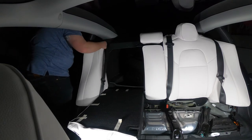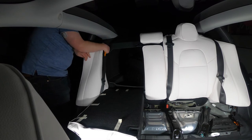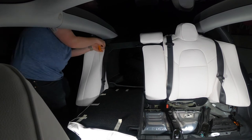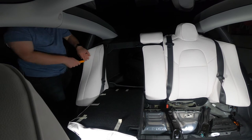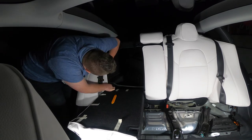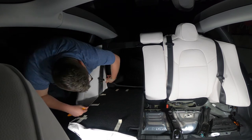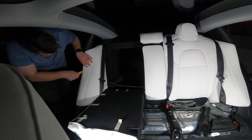You'll have a hard time feeding the straps up through the bottom, so make sure you use your wedge tool. Work the edge pieces into the grooves — be careful doing this because there are clasps in there and you don't want to snap them. This is very involved; be meticulous with it. If there's any puff in it the door won't shut properly. The inside edge has a stiff piece so it'll be easier to get in first. The top and bottom corners you'll have to stretch into place. Sorry for missing footage on the other seat covers, but follow the same process. The headrest is really easy — there's one velcro strap in the back. The middle section is really simple: just zip it together.